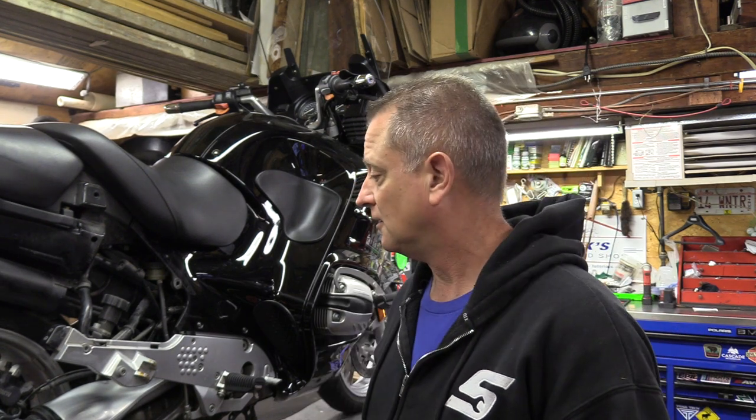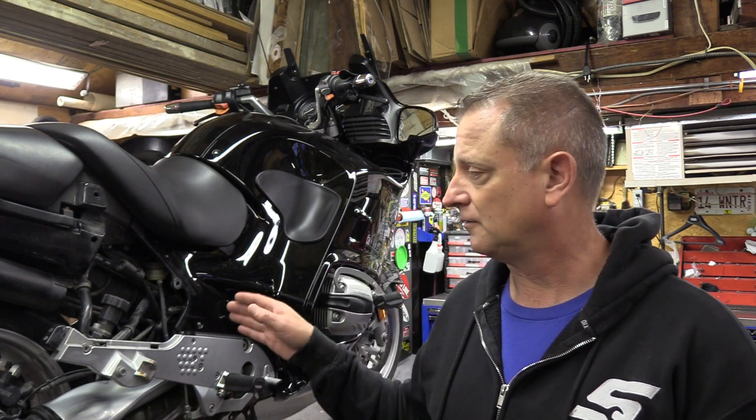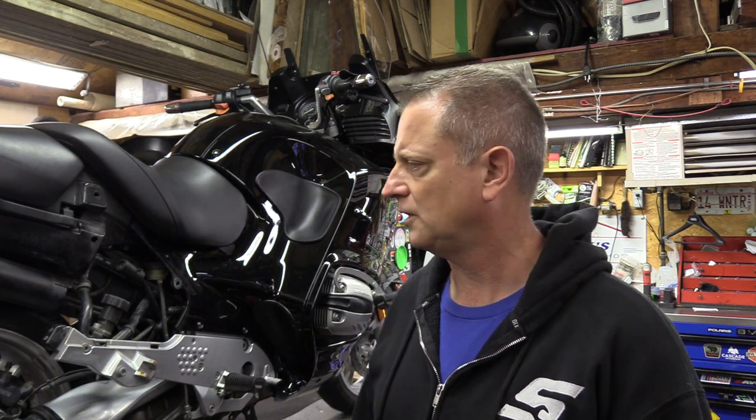They're the best lines you can buy to replace the OE lines — those garbage OE lines that BMW decided to cheap out and put on these motorcycles back in the day. They're rubber brake lines, or rubber-coated brake lines, and they break down really bad. They're very unsafe at this point. When they were brand new they were fine, but BMW only rated them for about six years.